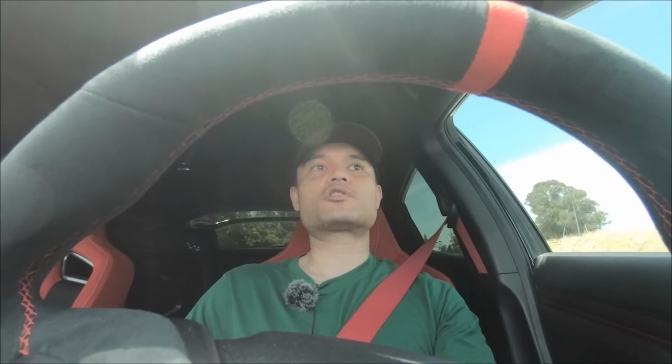And what I can tell you now is, even just driving it around on regular streets, it feels like a sequential shifter. If you guys ever see those sequential shifters in WRC, World Rally Championship, the shifter is just a very short motion forward and backward, and there's no clutch for those guys. It's just a shift forward and a shift back, instead of having the paddle shifters up here, because their movements are so violent. They have to have a shifter down off to the side and not on the steering wheel, because there's just too much going on to use the shifter on the steering wheel. So they got the shifter down where we have it, but it's a sequential shifter without the clutch.